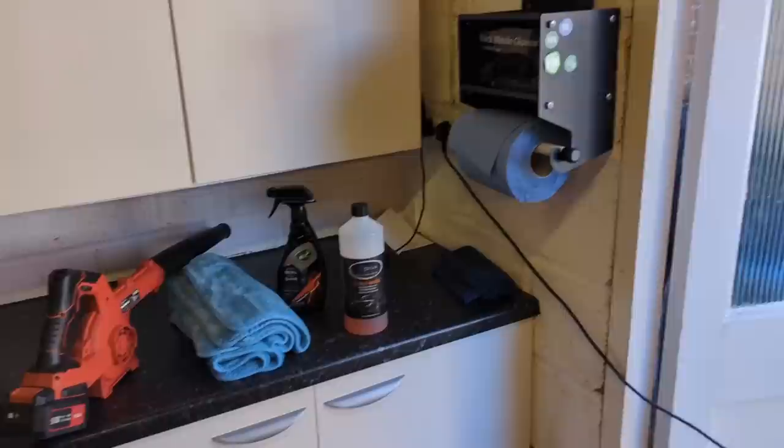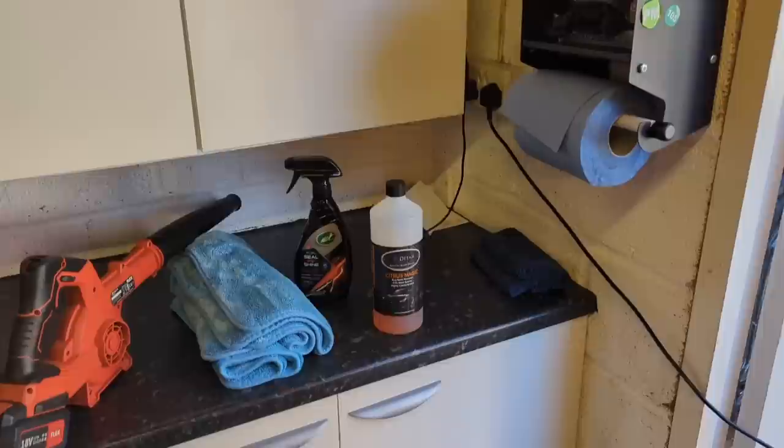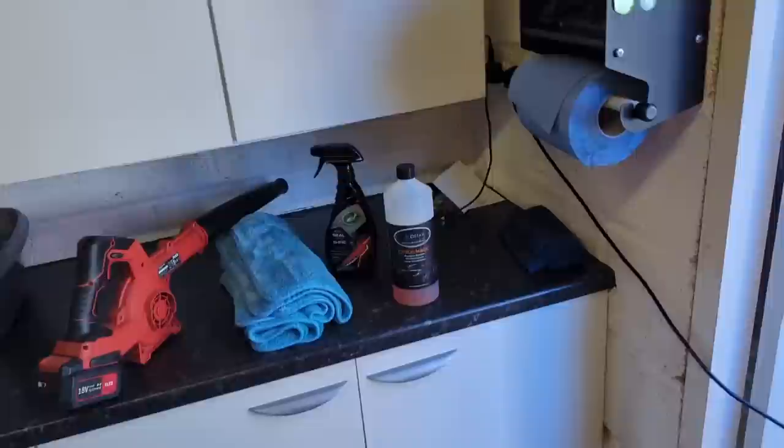What PIR should I use if I'm snow foaming my car? As a general rule, don't use a concentrated product beyond 5% PIR — that's a good rule of thumb when using it as a pre-wash. This product is still effective around 2% PIR, maybe even lower. At 2% PIR, that's roughly 200–250ml of product to 750ml of water in the lance. So roughly 250ml product to 750ml water — you could go 200 to 800 — and the product will be effective at that.